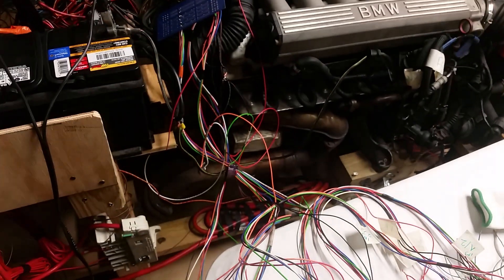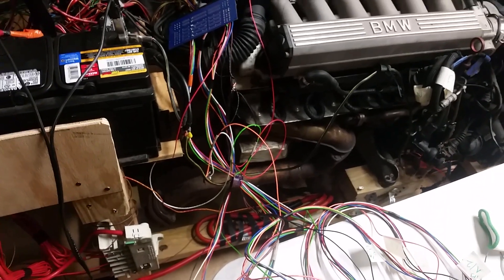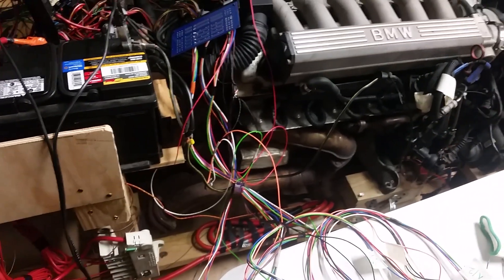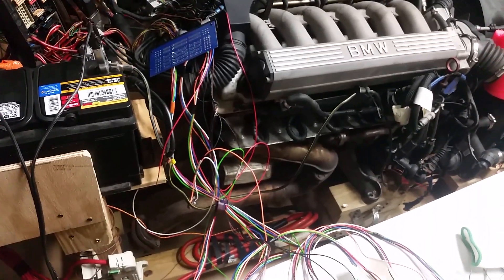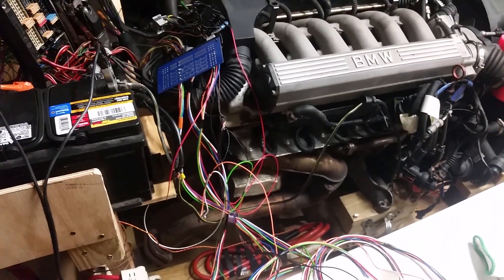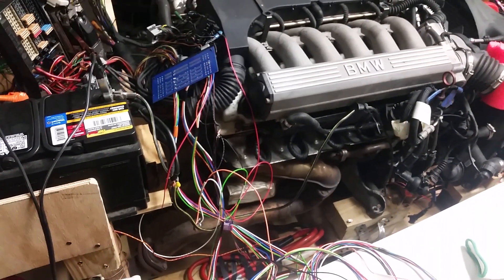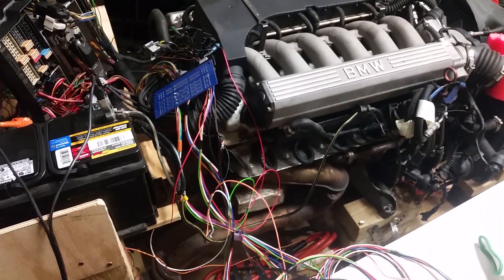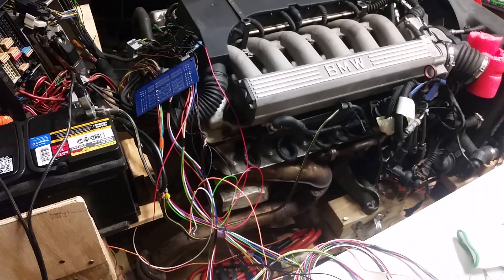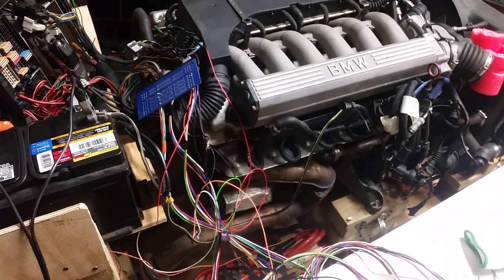I would also like to thank Bosch for having a universal 90-degree trigger offset. That means the top dead center is 90 degrees before the skipped tooth. I just put the value into the firmware and it just started like that. So there was no timing light this time.